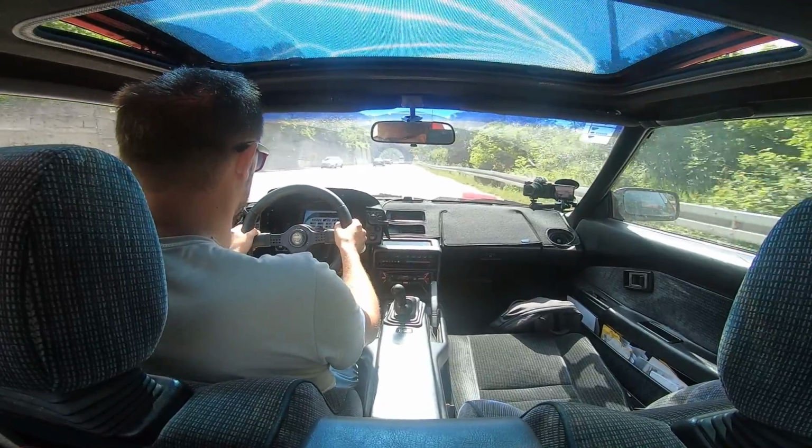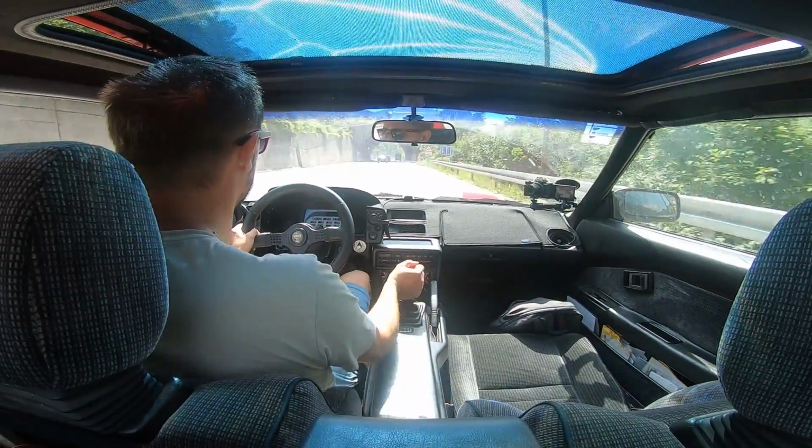Okay, this is a million times better than I expected for a first drive. It's very smooth, very OEM-ish. Okay, let's see how much boost we actually made. Okay, we got around 7 PSI, 7-8 PSI. I can see that, so it seems very good. The AFRs seem to be going stupid rich under boost. I did put that as a precaution to be safe, but they're doing like 9, which is a bit too much. I would prefer 10 and a half something.